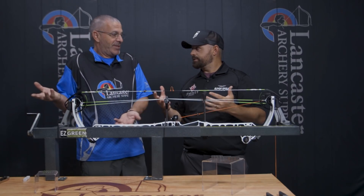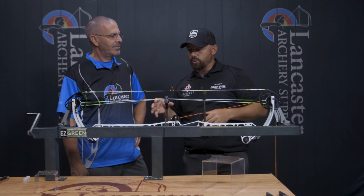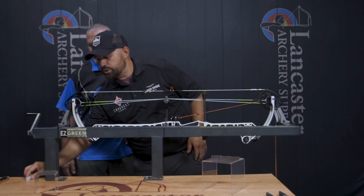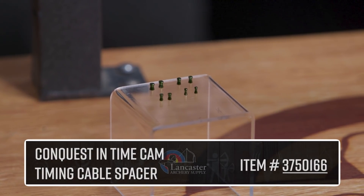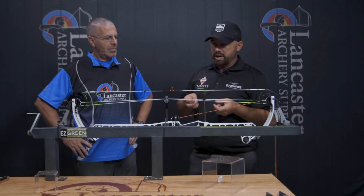You only have half twists — that's all you can do. I just wanted something that was a very repeatable method of being able to incrementally bring those cams in together to where they're actually timed together. The simplest way I could do that — and I worked through different sizes as well — was to develop these basic spacers. They're the In-Time cam timing spacers, and they're a series of basic hourglass shapes that hold their position in the cables without needing to be tied in.